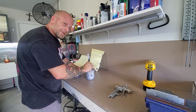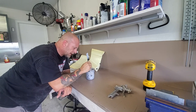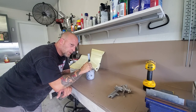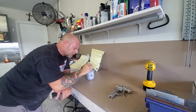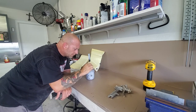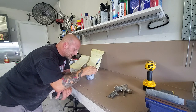Adding fish eye eliminator is just a little bit of insurance — if we do have a little bit of a reaction somewhere, it's going to help subdue any fish eyes. I'm also going to reduce it down — just one small shot of reducer. On your mixing scale it'd be 4-1-1. That'll reduce the amount of texture and orange peel when we spray, which will save us work when it comes to block sanding later.